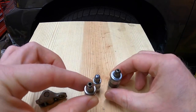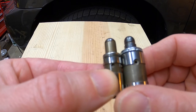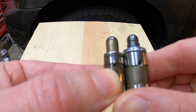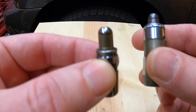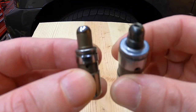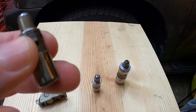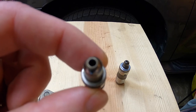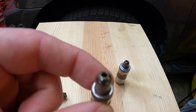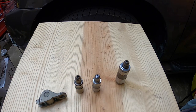Now let me show you something else. This part is not from Ford — it's from a Ford competitor, and it's actually a 5.4-sized lash adjuster. The input hole is about the same size, maybe slightly bigger. But the output is larger — and this competitor's engine does not have this rattle noise. No one has complained because it's properly engineered. This brand uses 0w20, not 5w20 like Ford. Can you switch to 0w20 in your Ford? My Ford doesn't recommend it — you would have to try it yourself.